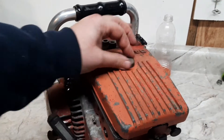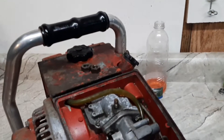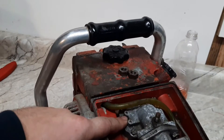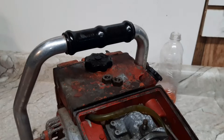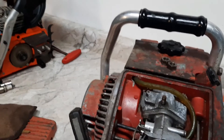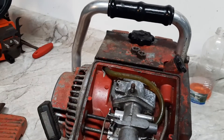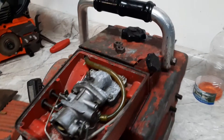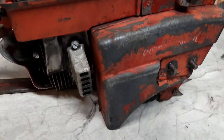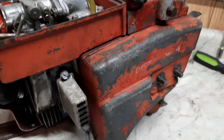This is 80cc's. It has a big flat air filter and a Tillotson HL carb. Flat reeds in these — the bigger XPs had kind of a pyramid-style reed. Here's your idle screw; you either adjust it with the L needle or you have to take the filter off and adjust the idle here. Choke knob, manual oil only — pump it and it squirts oil out. It has the stack-style exhaust. That's how they came, that's why it has such a nice tone to it.